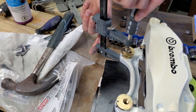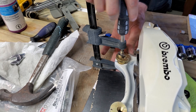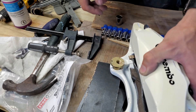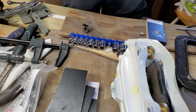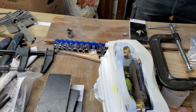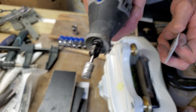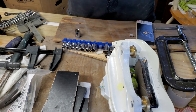What I'm doing now is just getting it on there — it's not gonna be straight yet, but you can fix it with the hammer. As you can see, this is not straight at all, but it's good enough to figure out where you have to grind on the adapter. So you take your Dremel and you need a tungsten carbide cutter — this one is already used but it has all these little teeth on it which grind on the caliper.